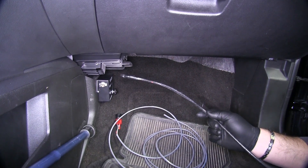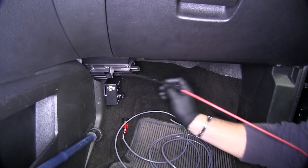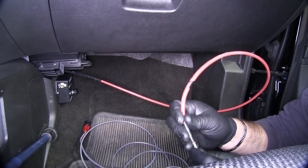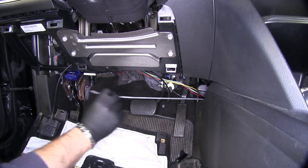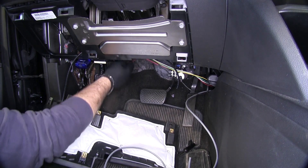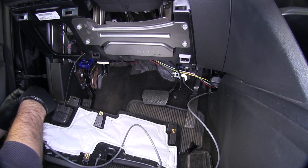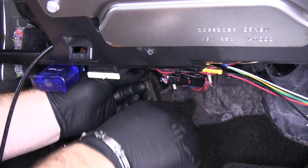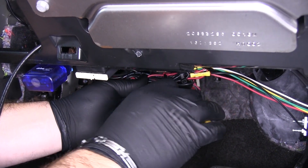I'm going to take an airline tube — you can use a wire hanger if you want — and feed it back through there. I'll take the wire and attach it to it. So we can see all of our wiring here going to that G-Force controller. I'm actually going to cut the zip ties off because they're running through that grommet. I'll see how much wire is left and may attach this to help me pull it through the grommet. If this idea doesn't work, no harm no foul — we just put a couple more zip ties on and we're back to the way it was.